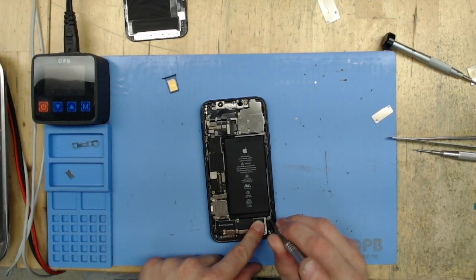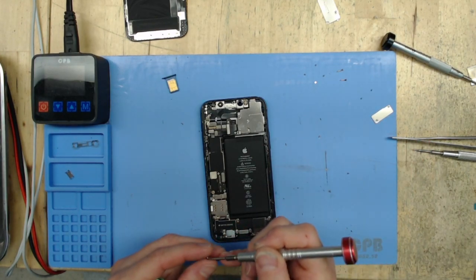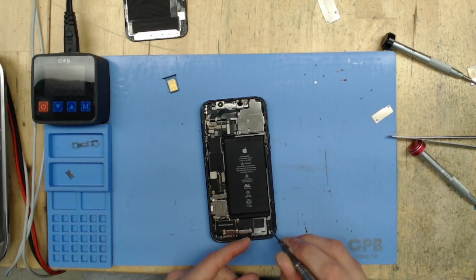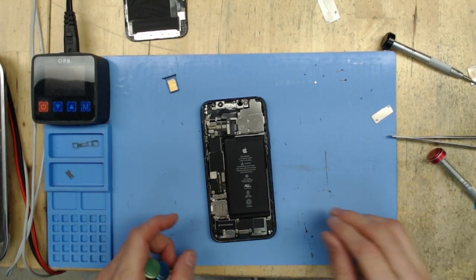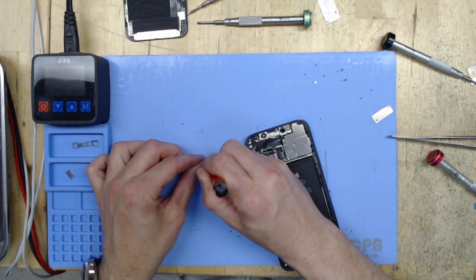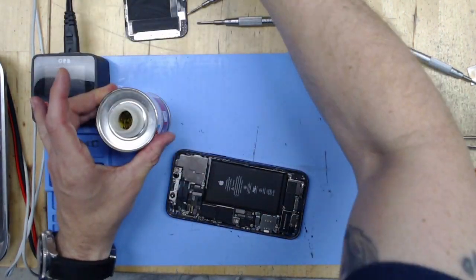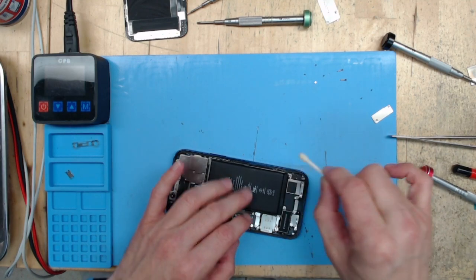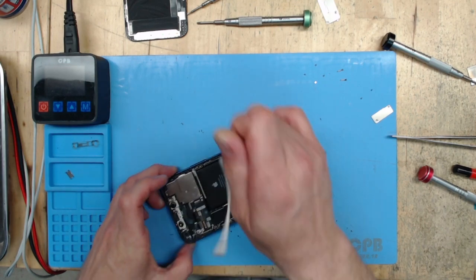Getting the Phillips in. There are a lot of screws involved — every time I touch that screwdriver to the mat I'm picking up another screw. A lot of people seem to be impressed with magnetized screwdrivers, but really this is elementary science — you tap a piece of ferrous metal on a magnet. Here I'm cleaning the SIM card; it looked a little crusty so I used a fiberglass pencil to clean it. Now I'm going to use some adhesion promoter — the adhesive was very good still; the phone opened without damaging it, so I'm just going to freshen it up.